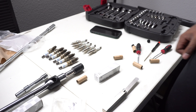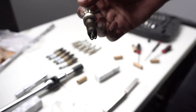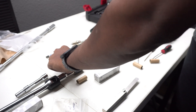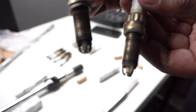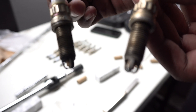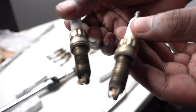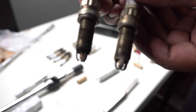One interesting thing I noticed is that I believe my Cylinder 1 injector is leaking. They're Index 6 injectors, so I kind of expected this at some point. As you can see, the end is very black in comparison to, say, Cylinder 6, which is not at all. These still have quite a bit of life left in them, maybe not Cylinder 1, but the others do. You can see the color difference — most of my other cylinders look more like Cylinder 6.